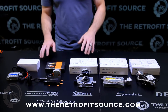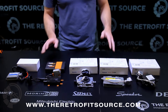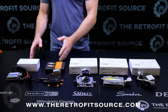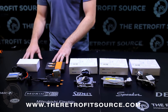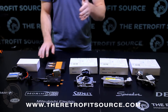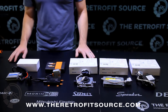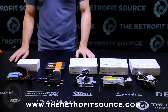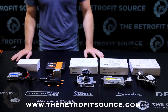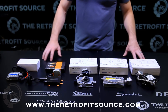For people customizing headlights, the ability to choose a higher-output ballast, such as a 50 or 55-watt ballast, is often desired. You're never going to get that with an OEM ballast like the Matsushita, the Denso, or the Mitsubishi. You'll have to look to an aftermarket ballast for that higher output. The Morimoto standard is the XB35, which is 35 watts just like the OEMs. But if you want more output, you'll need to look at the XB55. The same goes for generic aftermarket ballasts — it's very common to see 55-watt versions, though whether they're accurate in terms of that output is hit or miss. At least they'll likely get anywhere from 40 to 50 watts if you pick a high-wattage cheap ballast.